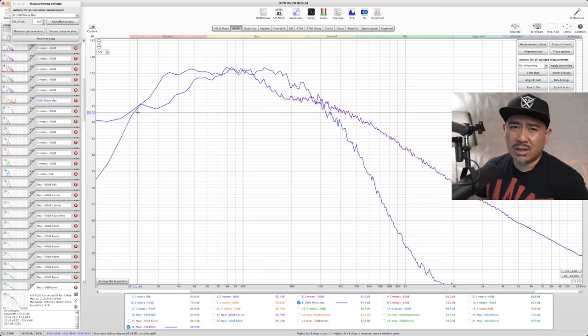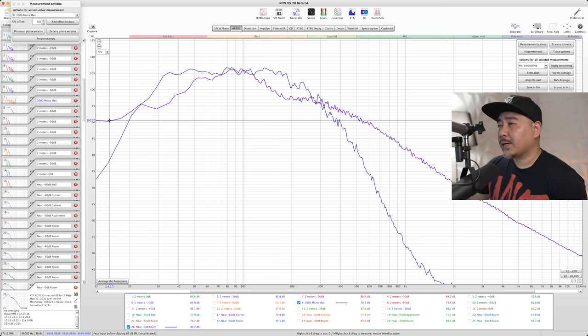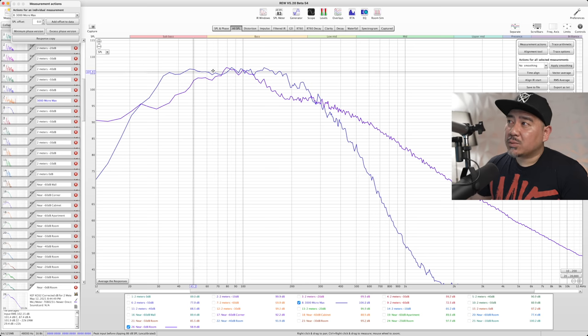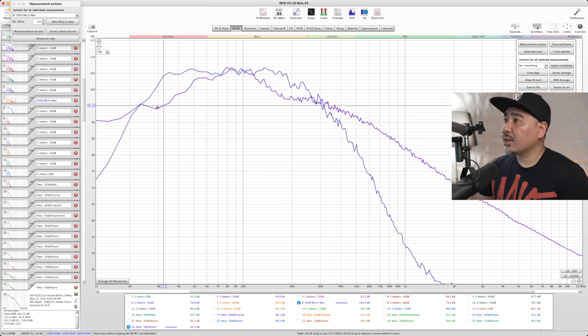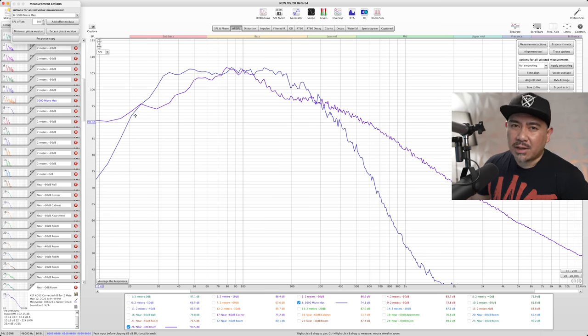How much that matters in the real world is hard to say — at 90 dB it's not really what you want for movies, but for music I think it's good enough. The SVS does have more output at max volume, with more low frequency extension up until 23 Hz where it falls off. The KEF has a huge dip but still extends a little further. The dynamic EQ does work — it does a good job of extending bass frequency. If the SVS had used dynamic EQ, it would have had even more output given its dual 8-inch drivers versus the KEF's dual 6.5-inch.